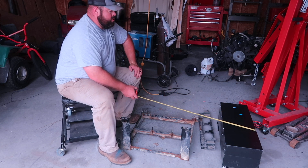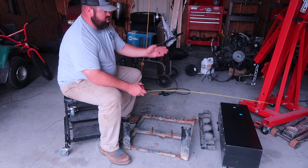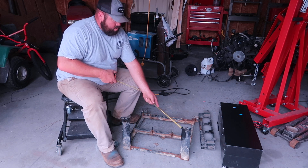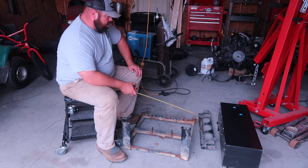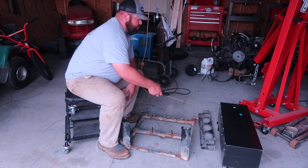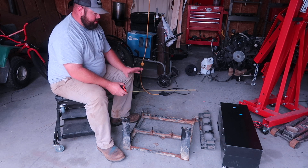So we could be looking anywhere between 85 and 90 volts on this golf cart system. We got both of these batteries here and we've got to accommodate for the plugs. The power and ground plug come out on the passenger side here. Not sure if I'm going to be able to put both of them just like that into the golf cart. I might have to make one facing forward and the other one facing in reverse in order to fit it between the dimensions of the EZ-GO OEM battery tray. Today we're going to be getting the metal cut, welded, and trying to make something to mount these batteries. I might just take those wheels off and make them fit really nice and low into the frame with a strap to go across the top.